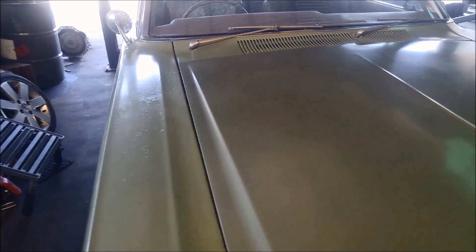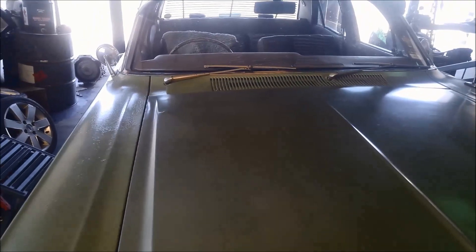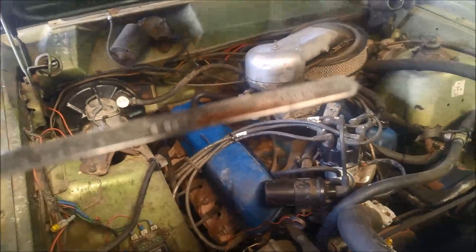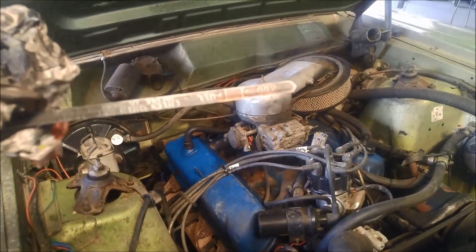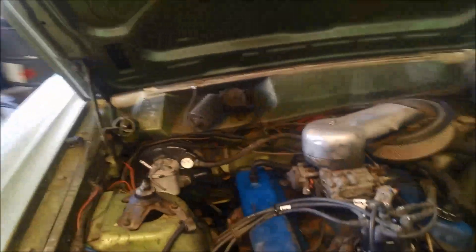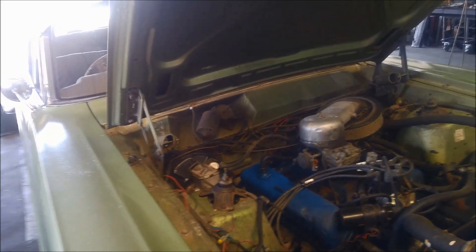Four liters went into it — eight pumps. I'm going to take it for a run now and check the oil level at operating temperature. From the test run you can see it's right on the top mark. I've shown you how to do the band adjustment, fix the linkages, and service a C4 transmission. Thank you for watching.